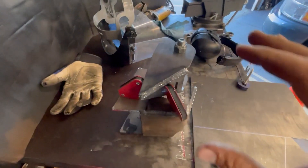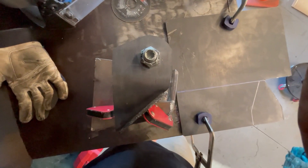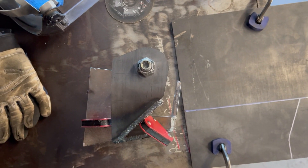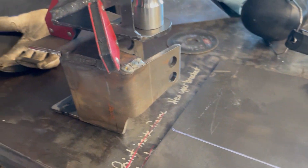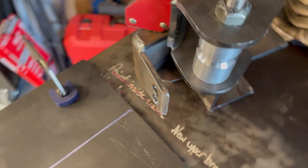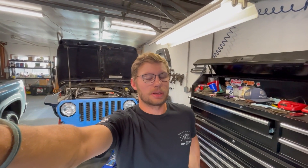I'm sure you'll understand that better when I actually do it. From the top down you can kind of see how much I'm going to be shaving off - that's probably about an inch, should be an inch from what I measured. I do really think that's going to be enough to get me that clearance I need. And if not, I think when I do the alignment I'm going to be very close - so if it does contact, I'll just push the front axle over until it clears. But I'm going to work on fitting that bracket up there and see what happens.